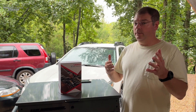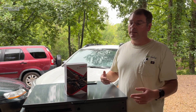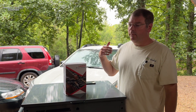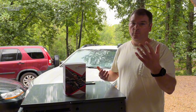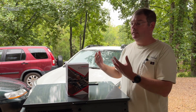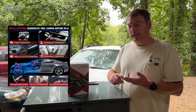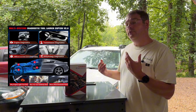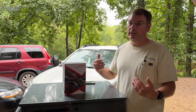What we're looking at is not just next generation, obviously version 2.0, but this is next level. You have a code reader which gives you an OBD2 code and tells you what's potentially wrong when your check engine light's on. Then you have a base low-end scan tool which gives you more code reading, maybe oil light resets, maybe graphing live data. The CRP129i version 2 has the next generation of that — 12 reset functions in addition to the usual OBD2 code reading. You can get into the engine, transmission, airbags, and ABS systems for deeper diagnostics. It also has FCA Auto Auth, which lets you work and communicate better with newer 2017 and newer Chrysler vehicles.